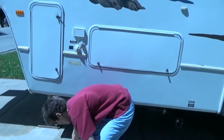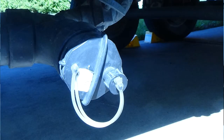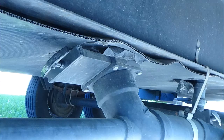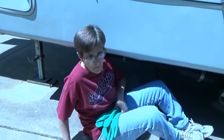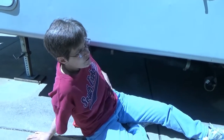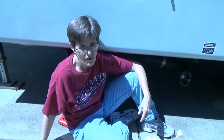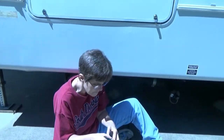Before you get started, I strongly suggest that when you're under there before you disconnect the cover, check all of your valves. This one has, as I showed, three valves: gray water, black water, and galley. Always make sure those are all the way in. If one should jar loose a little while driving, the worst you'll have is maybe two feet of something to deal with when you take this plug off — otherwise you've got a bad situation.